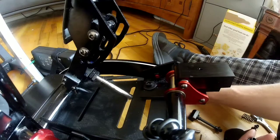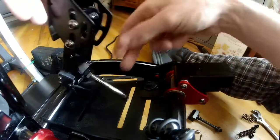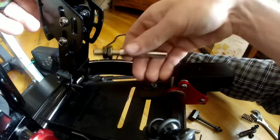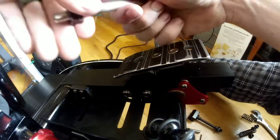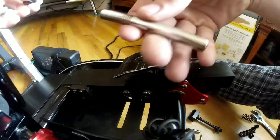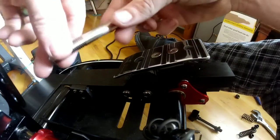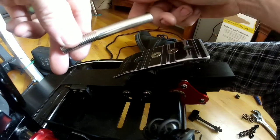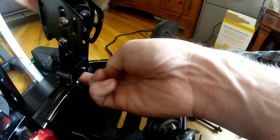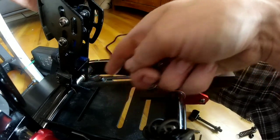The spring and the large flanges, if you have that, are no longer useful. Now you'd probably want a 17mm wrench because it's probably on there tight, but mine's loose because I've done this before. We're going to unscrew both of these all the way until you just have the rod. Now you're going to want to wipe the rod down — wipe all the grease off your rod because we want it to be as dry as possible for this next step. Take whatever you're using to dry it off with and wipe it down inside the threads of this bottom part as well.